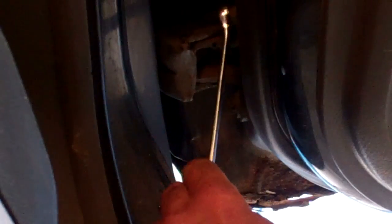And whenever I loosen anything off, whether there's multiple bolts, I'll loosen each one off. Do the ones up top. Loosen them all first before you get too aggressive about anything. Make sure you don't have any seized. And then kind of go back and forth like that. So I'll get them all loosened off. I'm not going to take them right off because this door is going to fall off of here at one point. So I'm going to build a little something to stabilize everything.